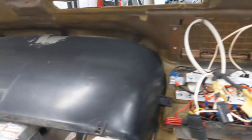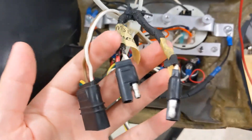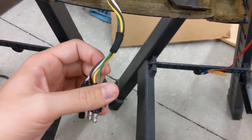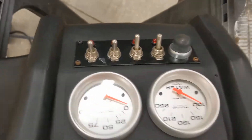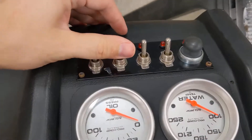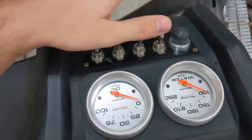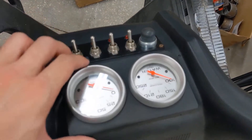This is the back side of the dash pad. There are two gauges wired in, and these trailer connectors connect to the ones in the dash, which connect to the fuse block. All four of these can have power, but one fuse is missing and the fourth switch just has a pigtail. The switches were just three — they'd turn the gauges and ignition on and then push-button start, so you didn't need a key.